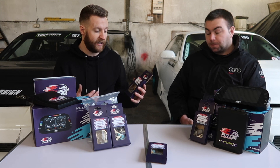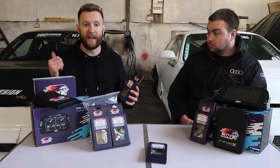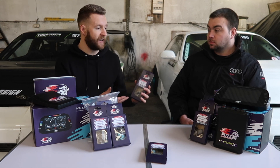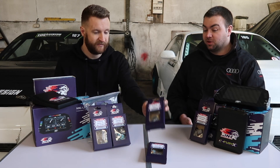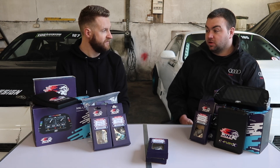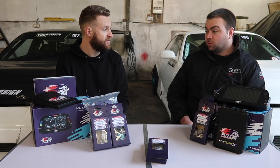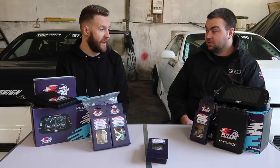The air temperature sensor is kind of self-explanatory, but any car that does not have an air flow meter does need an intake air temperature sensor to run the engine correctly. Air flow meters have been getting to be an outdated technology — in my 180, mine has been gone for a few years since I upgraded to the MoTeC. You've seen the limitations in your cars as well, especially trying to run big horsepower with those old air flow meters. The most common one everybody uses is the Z32, which I maxed out on the dyno at 500 horsepower — you actually can't go more without getting rid of it. If you did, your tuner would be mapping blind, not knowing what's happening in terms of air flow, which puts your engine at risk.